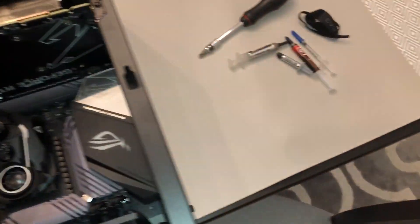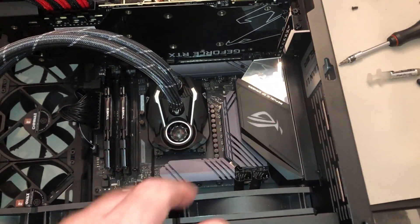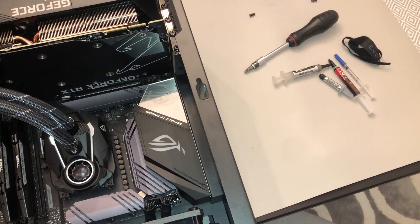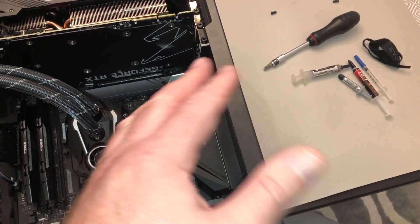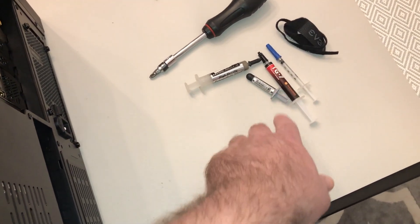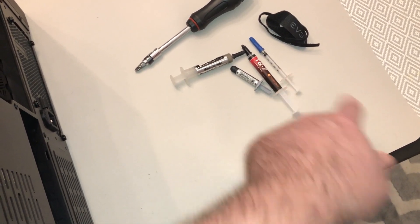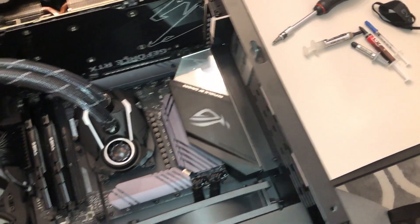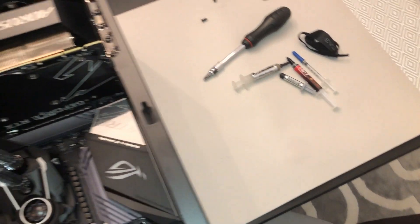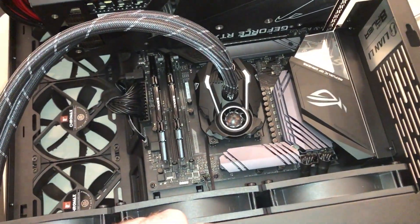It's quick and easy to do. I've got a bunch of thermal paste here — I've got MX4 on it right now. I've done tests between the different thermal pastes and have never seen any meaningful differences beyond normal error between the types. I've got Arctic Silver here, I've got some TG7 from Thermaltake, and I've even got some liquid metal left, though I'm not going to be using that on this — I use that for de-lidding. I've tested MX4 against Arctic Silver 5 specifically and found them to be absolutely identical, so that's what I'm going to be using.